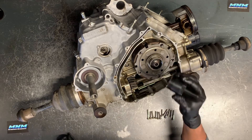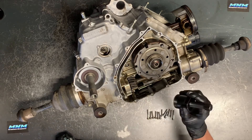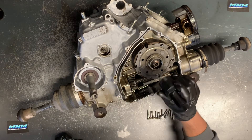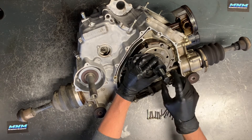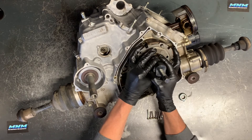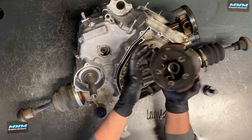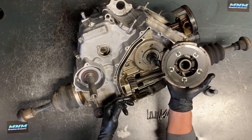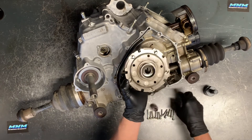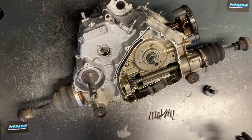Now that we have the centrifugal nut off, what you need is a puller that looks similar to this — I do have these available, click the link below to make sure you've got the right one for the job. I've had countless people tell me they've really screwed up the threads on their crank or their clutch because they used the wrong puller. Thread this in, then pull it up just like a flywheel puller — it'll all come out like this. Unthread your puller and your clutch is off. That's what your centrifugal clutch looks like. This washer and nut go back in the same order — don't forget your nut.